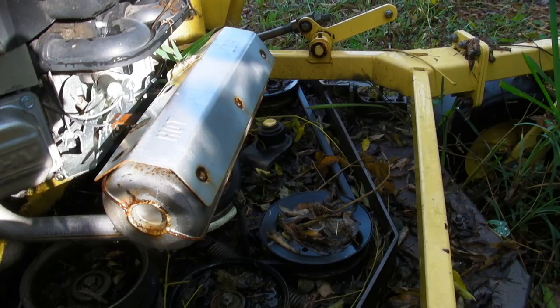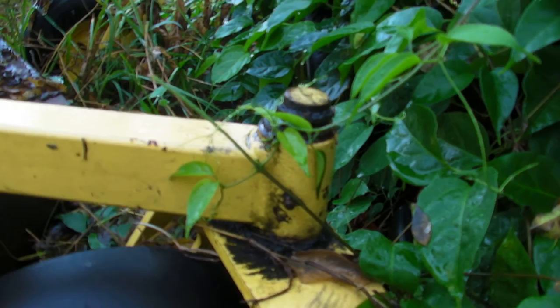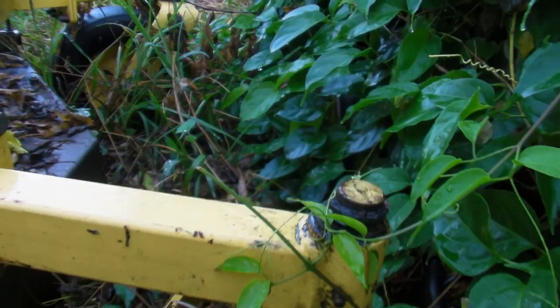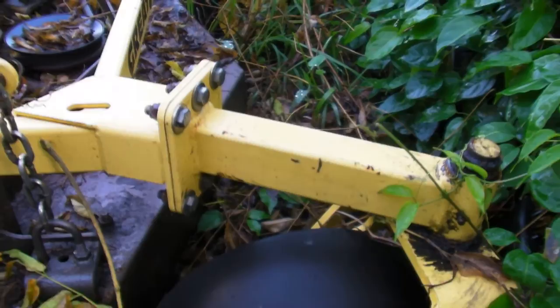Now, the problems — the things I'm going to have to hunt down. The front forks here, the yokes — they go up into that shaft, from here to here. That yoke itself is worn, so even replacing the bushings isn't going to solve that problem. I need to hunt down two front forks, because they're both worn like that. But the bearings inside the wheels are fine, and the tires are fine.